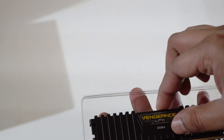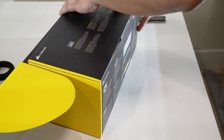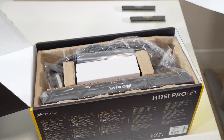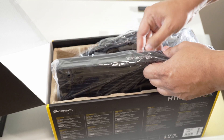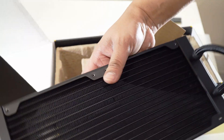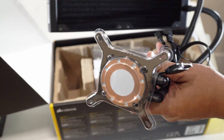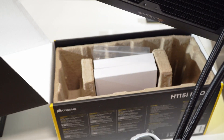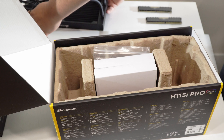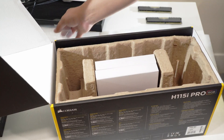but also keeps your computer nice and speedy. You need good cooling to cool those monster 16 cores, which dissipate a lot of heat, while keeping the system less noisy. So this is our liquid CPU cooler. AMD recommends using a liquid cooler for this Ryzen CPU. The radiator on our cooler is a 280mm size. This was the maximum size we could fit in our case. You can choose to go with a 360mm radiator if you can fit it. This will sit on top of your CPU and cool it using the built-in radiator fluid, just like cooling your car's engine. This cooler comes with some additional connectors to monitor your cooling performance using software.